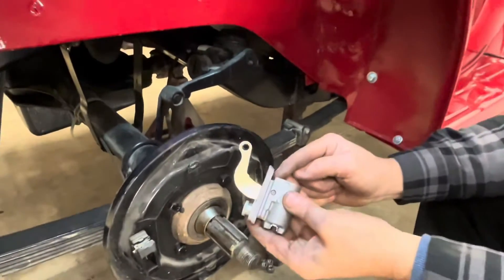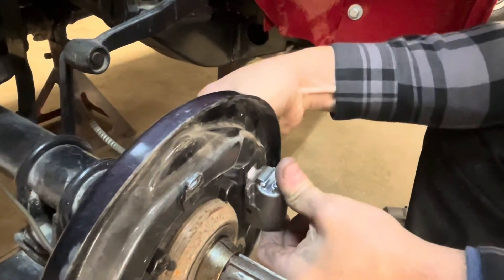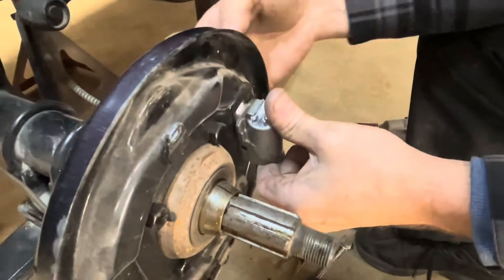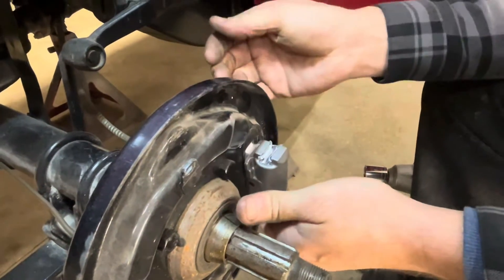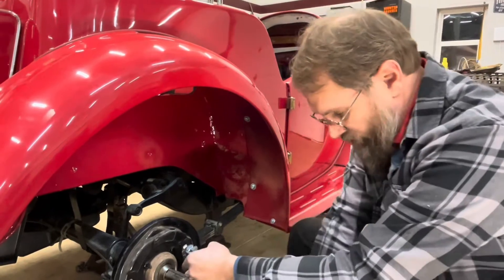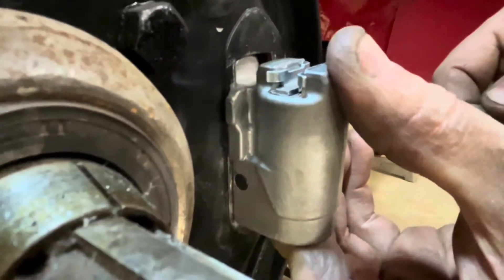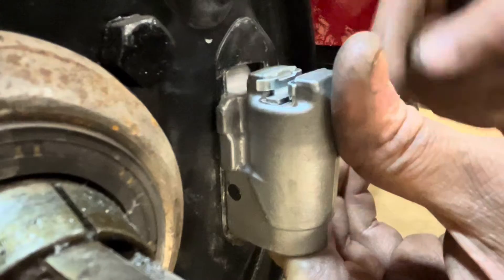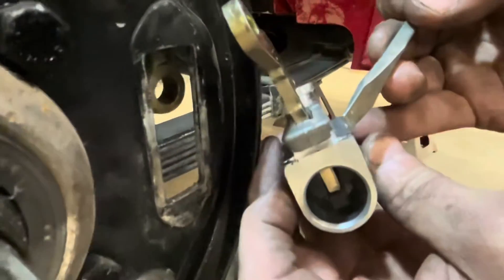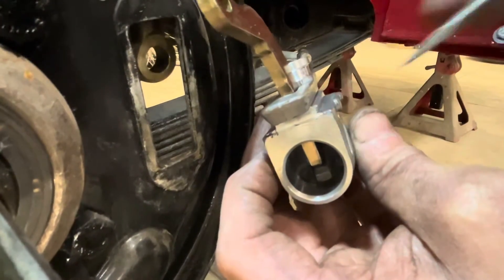So you can just drop it in, make sure this goes in behind, and then it looks like we've got a slight clearance issue - these may not be machined quite enough, and I'm seeing that a lot anymore on wheel cylinders. So I'll have to do a little filing on that to make sure it slides nice and easy and then we can continue. Basically you want this little piece here to slide up in behind there and be able to slide back and forth all the way up. It looks like this probably was supposed to have been machined across here just a little bit - there's a slight step there and that's probably what's causing it.